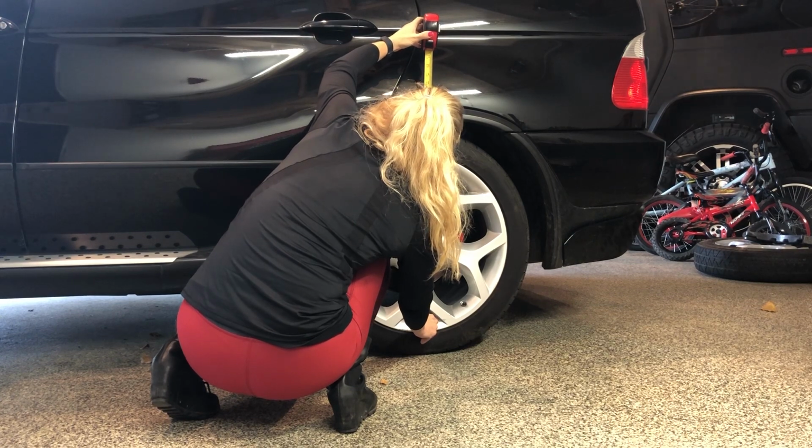Guys, I needed to fast forward a little bit. We were sitting there waiting for the air to fill back up in the shocks, but in reality, it was really helpful when we got the car out and kind of zoomed around town a little bit. And what we did, we came back, we measured to see where the air suspension was leveling off, waited a couple of days, measured again, just to make sure that we weren't losing any air in those shocks,